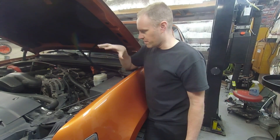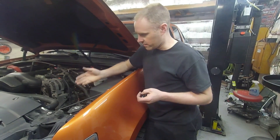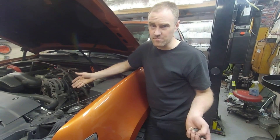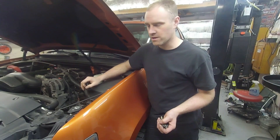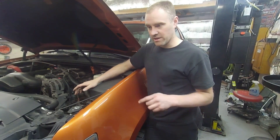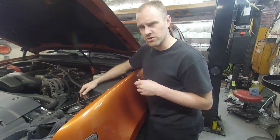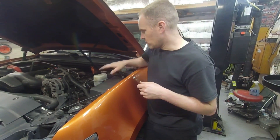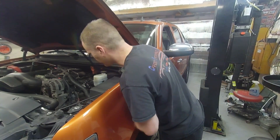I'm going to let you guys hear it — hopefully it'll do it for me. It is still a little bit warm yet, but this noise: you start the vehicle, it makes the noise, and then it goes away after just a little bit. Sometimes it'll be there all the time — that's in a more severe case. This one is not severe, just the beginning. The customer actually thought it sounded somewhat like lifters. I'm going to go ahead and start this thing up.